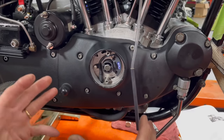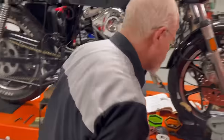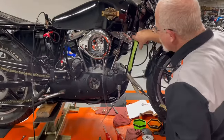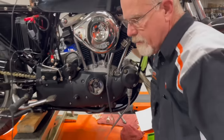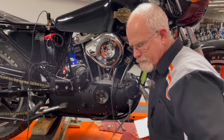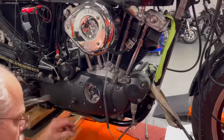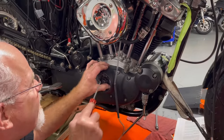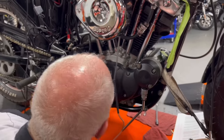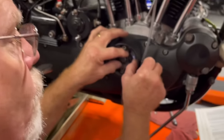How do I do that statically without running the motorcycle? What I do is take the spark plugs out and lay the spark plug right on the head so I can see it and hear it — and the hearing part is the major part of it. Then I'll reach over and turn on the ignition. I'll make sure the on switch is on. Then I'll sit down here and loosen this just a little bit.